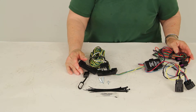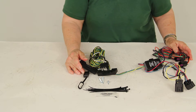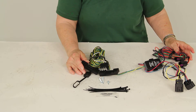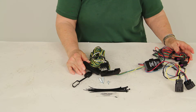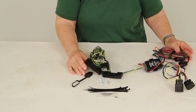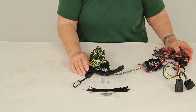You do need an extension loop to connect your towed car to your RV, and these are sold separately. If you have a four-way on your RV, use the Hopkins four-pole loop, part number HM47115. If you have a seven-way on your RV, use the Hopkins coiled wire adapter, part number HM47065.